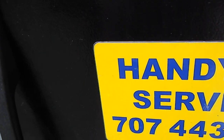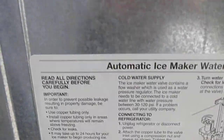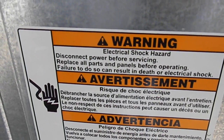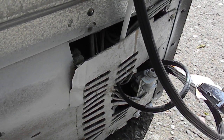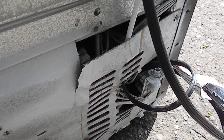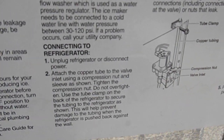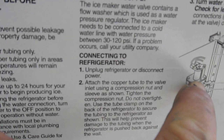Hi, it's Bill the handyman. Today we're going to look at ice makers — this is a Whirlpool. The easiest thing to check first is the water valve. You can manually run 110 volts to the water valve, which is tricky for people who don't work with electricity much. The best thing to do is use an ohmmeter and make sure you get a constant reading — there should be continuity in the valve between the two terminals. Sometimes the plastic part of the valve will become deformed, and if it's deformed it's likely to be bad.